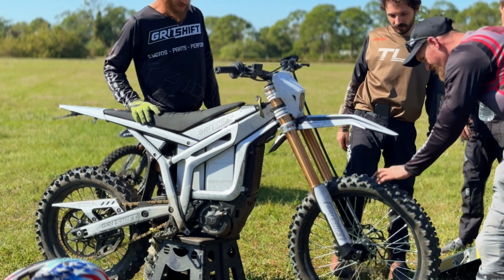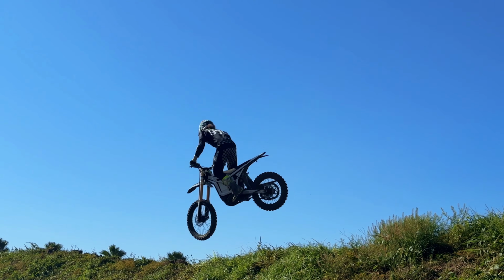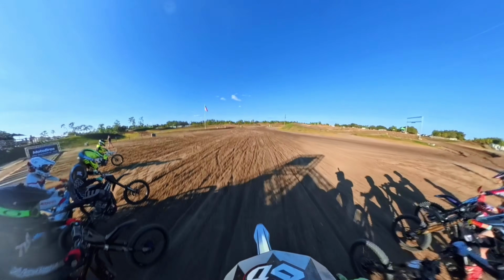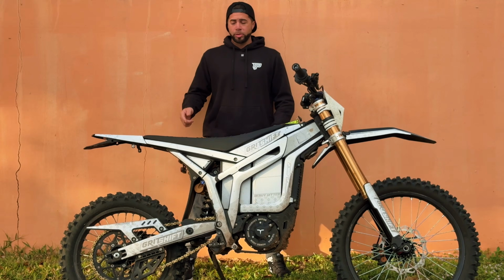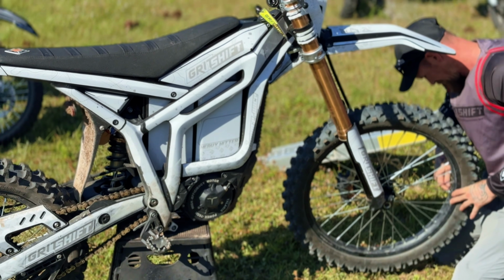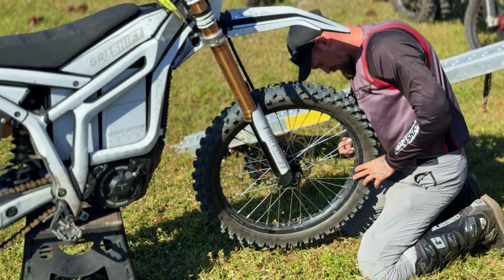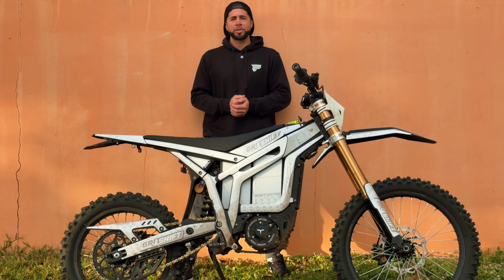The wheels both bent. We did 2 moto days, one at Miami MX, one at Moto Bros. At Moto Bros, we did an actual race event for New Year's. And Miami MX was just fun riding. At Moto Bros, we bent the rear rim hoop. All the spokes were loose on each rim. They were way out of true. Spent a lot of time retruing those. The front wheel is a little bent on the hoop as well, but not as bad as the rear.